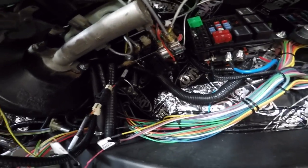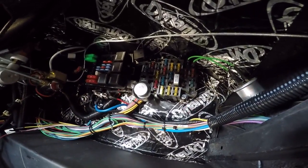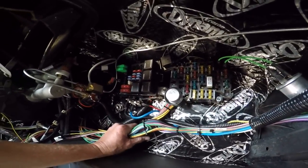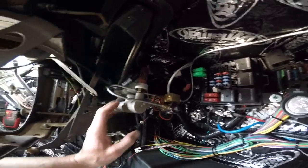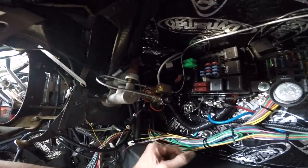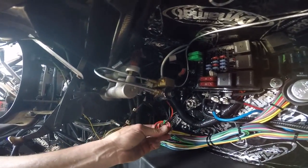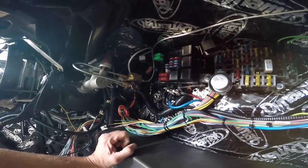This is the easy wiring harness right here — they're about $155 to $165. I really recommend those because I put about four of them in and they work great. This right here is my combination valve, I put it on all the cars. And this is a master cylinder from a Ford Explorer — the same one I got the rear axle out of. And right here, if you recognize it, this is what's called a line lock. You can hook it up to power and it blocks the line once you hit the brakes, so you can do nice little smoky burnouts without ruining your rear brakes.